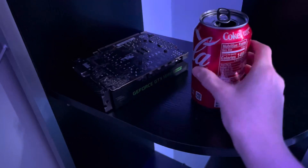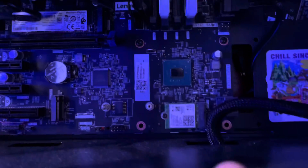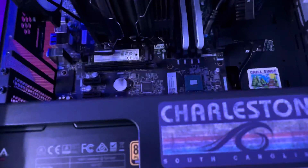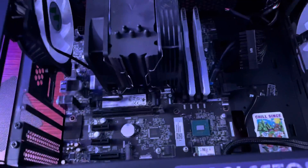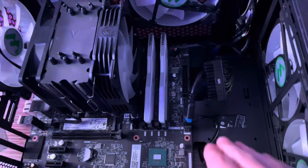Now we are ready to unscrew the motherboard. There are screws in various positions — for me there's one there, there, there, one up top, and three down at the bottom. Don't forget any screws — unscrew all of them and don't lose them. It's kind of hard to record lifting the motherboard out because you have to guide cables out of the way of the board. Once you do, I'd recommend getting the actual box for the new motherboard and just putting the old one on top of it for the time being, or on a different cardboard box.